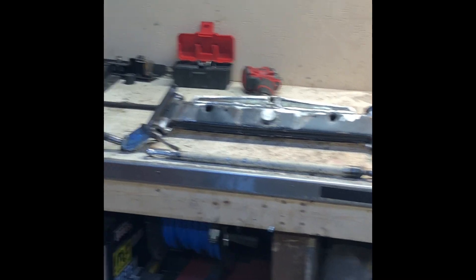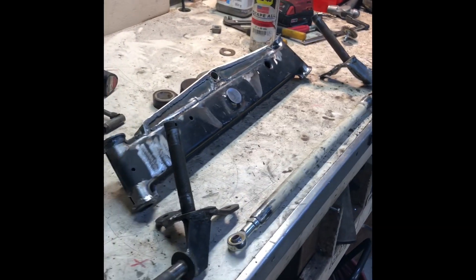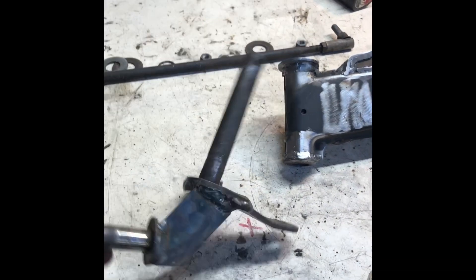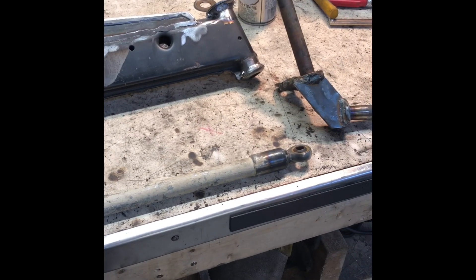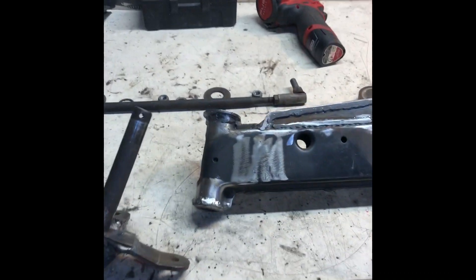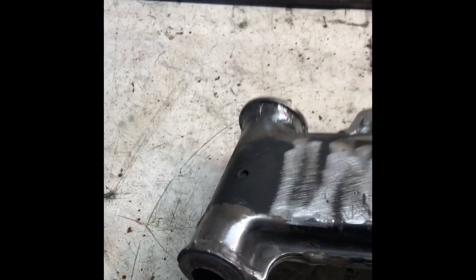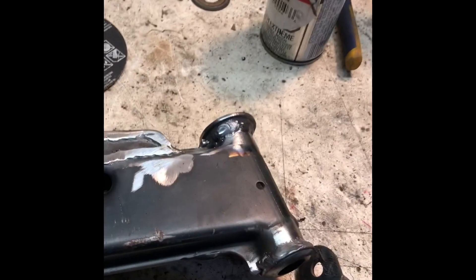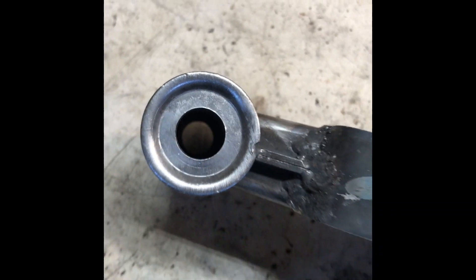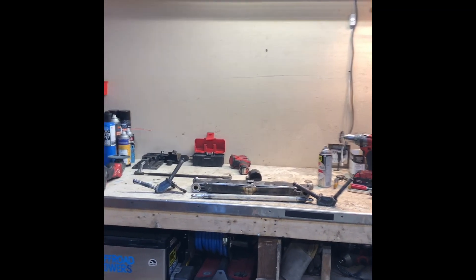Check that out! We've got some spindles, tie rod - check out them spindles, nice and strong. Put some kind of bracing in there so they don't bend - build your tie rods nice and strong. Then the actual I-beam itself. What I just did now is laid out the center washers - kind of cone washers, top and bottom - and that's both sides. You can see grease nipples on both sides, so I'll be able to grease the whole inside tube and not have to worry. Super sweet setup for Nick - he's gonna love it.